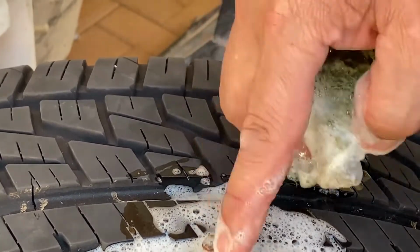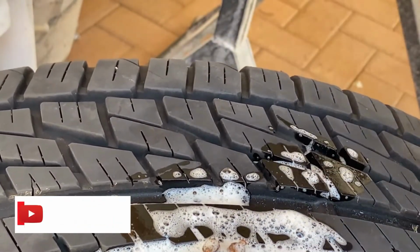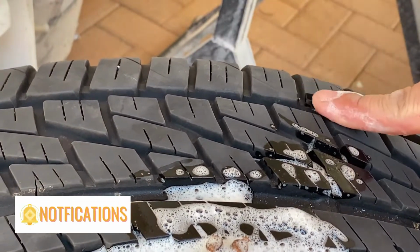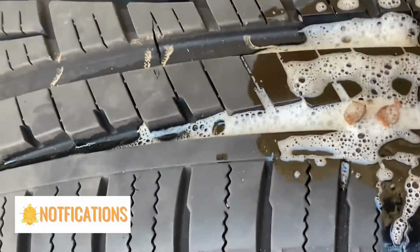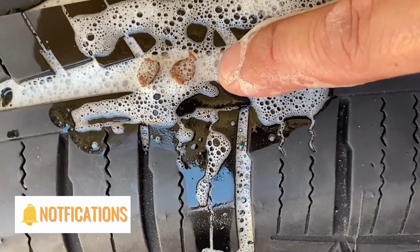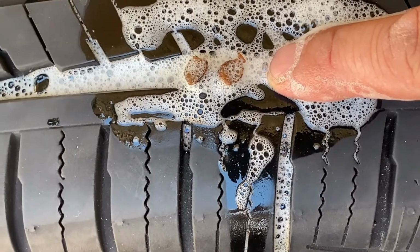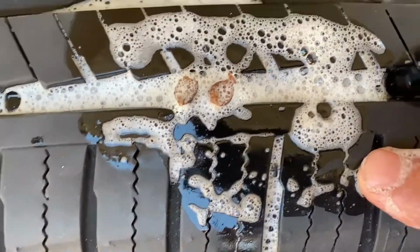And of course, let's not forget to do a test leak again. We'll use the same method to do the test leak. As you see here, the bubbling stops, and that's the indicator that the leak stops. Now that we know that it's not leaking anymore, we can put this back on the car and let's top it up with air.